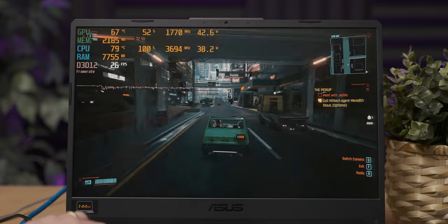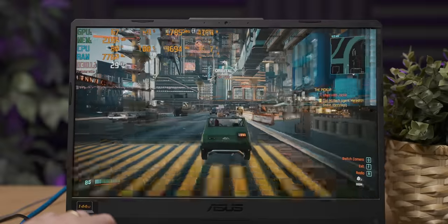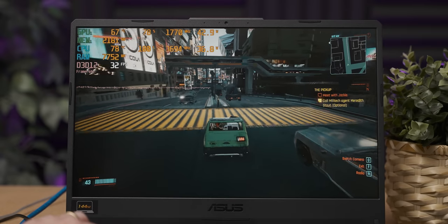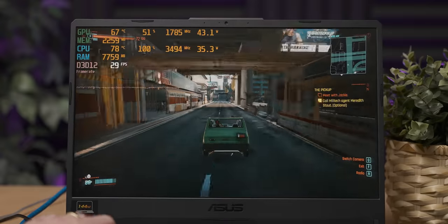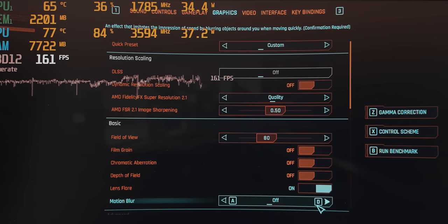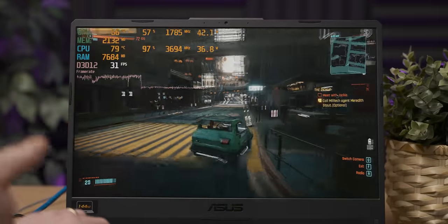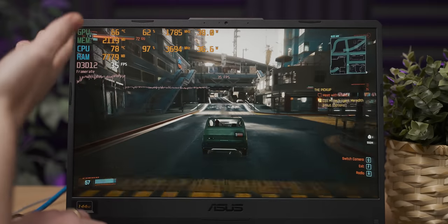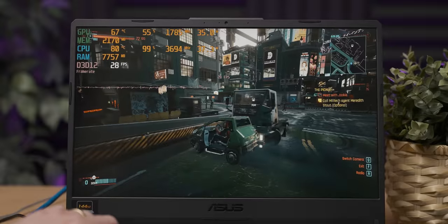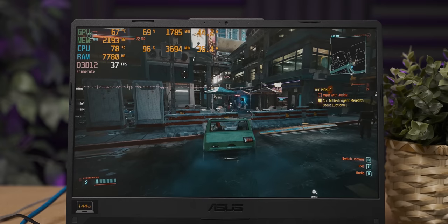It's settling in around 30 frames per second, dipping quite readily down to about 22–24 fps. It's borderline usable. I turned on FidelityFX 2.1 — obviously that wouldn't really help because the GPU isn't the performance bottleneck; reducing render resolution won't help when the CPU is the problem. I really hope the RAM upgrade is going to save this laptop because gaming performance-wise it's not doing well.